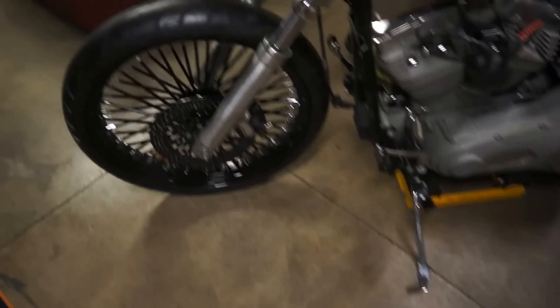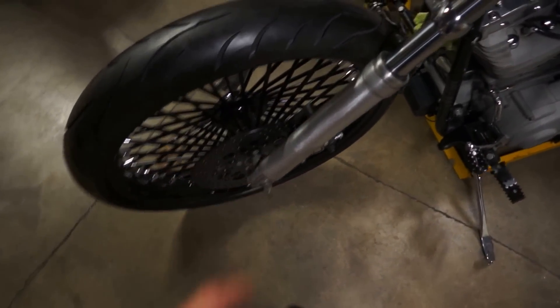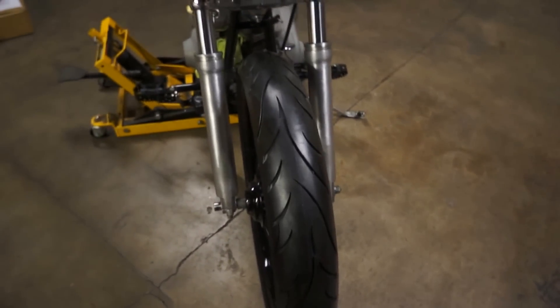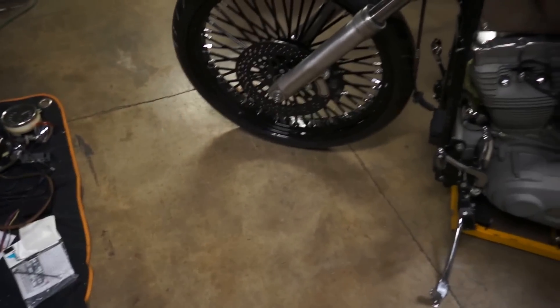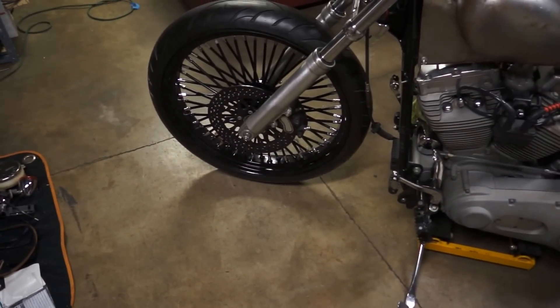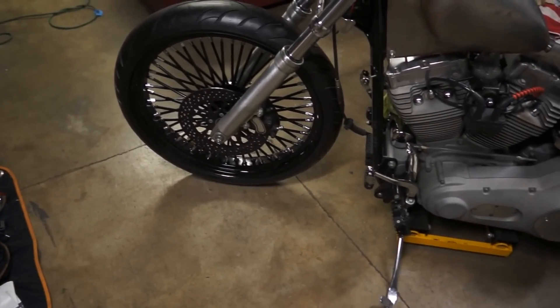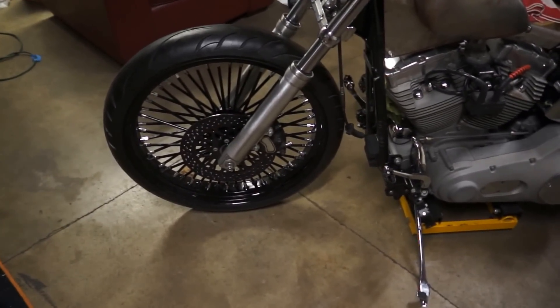Removed the front end again and shaved off the fender tabs for the front lowers. You can see these actually came out really good. These ones were not chromed like the last ones, which made the job itself a lot easier and they'll come out much, much cleaner. I actually need to give these a final sand — I'll probably do a couple passes with like 800 grit and then 1,000 or 1,200, something super high, and just get those really smooth. I'm doing gloss black, so everything needs to be about perfect or you'll notice any imperfection.